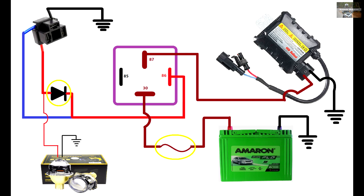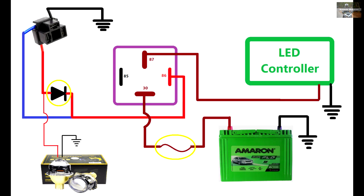The same circuit will also work for LED projectors, because they have almost the same concept. In place of the HID ballast, it will be an LED ballast or LED controller — low beam will power that up, and if there is a mechanical shutter, the same connection applies for LED projectors as well. If the projector comes with a 3-pin H4 male socket, you can use the previous design with two relays to power up the H4 type bulb — the same concept applies for LED projectors with an H4 pin.